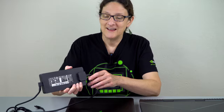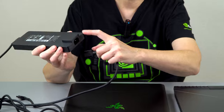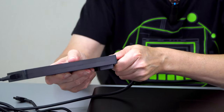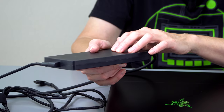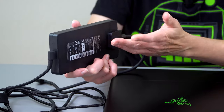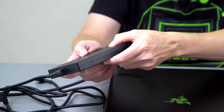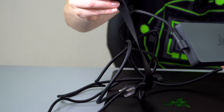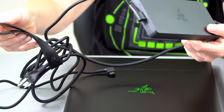The power supply is even skinny. They've had to add a little buildup area to facilitate the area around the plug, which I suspect also helps the power supply stay cool. It's 250 watts — very ample capacity for what's inside. Even the power supply gets quite toasty when you're using it for gaming, just because it's so thin and you're right against all the capacitors inside. There's plenty of cord with the usual nice fabric cover.